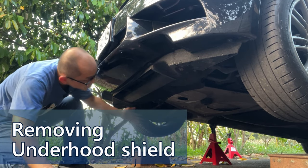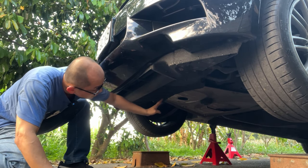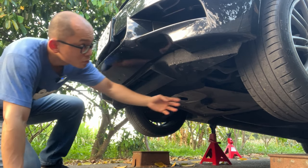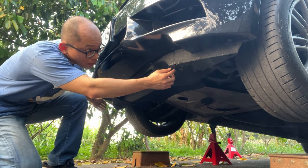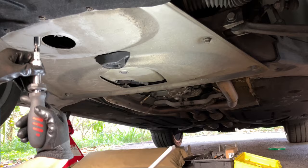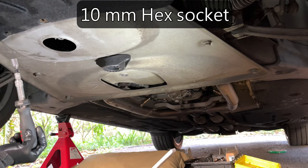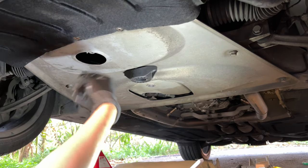And at last, remove the holder and we can access the plug. Before that, we need to lower this protection trim a little bit so we can access the front screws — two screws at the front of the reinforcement strut. We don't have to release all the screws; release two in the rear wheel area and the holding rack here, so we can make an opening and access the two front screws.